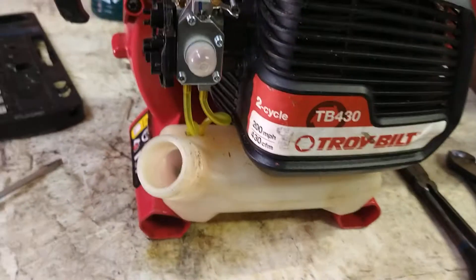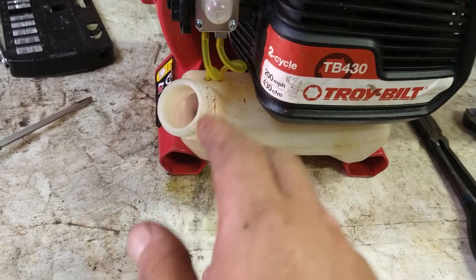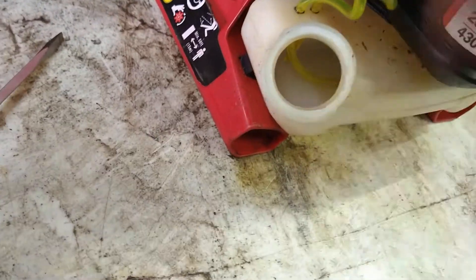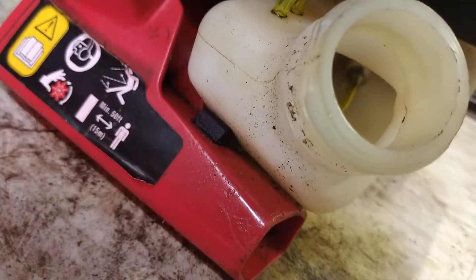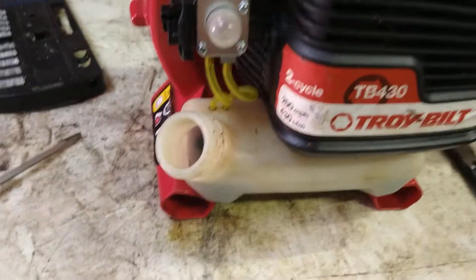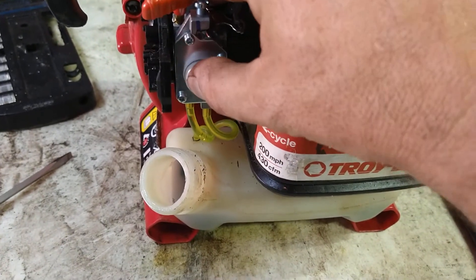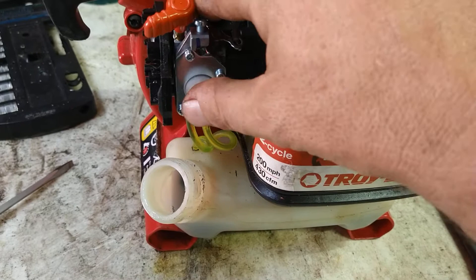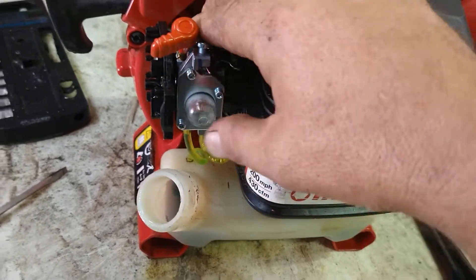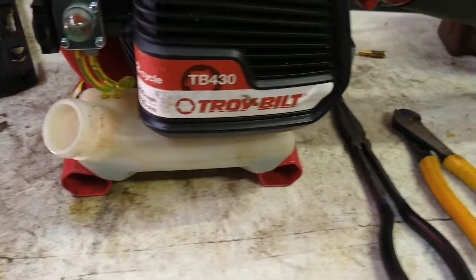Good time to figure out if we've got the lines on the right way. Put some gas in the tank and prime it up. If it doesn't prime and you see fuel or foam coming out of your fuel filter back in there, that means you got them backwards — just switch them around. Mine's a little rich just so you can see it. See, it's pulling it up. Perfect. All right, gas cap on so we don't spill any in our laps.